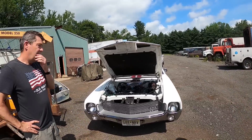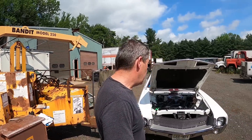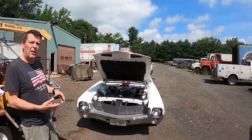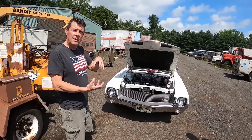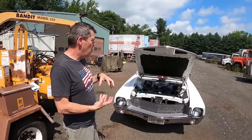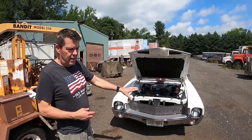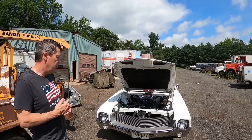They did make a good car — this is an awesome car. Thanks John for sharing it. It's a work in progress — going to continue making it pretty. These cars, up until 1970, had something called a trunnion, which is an old-school suspension system built underneath the coil, and they go bad — you've got to replace the bearing, the bushing. So that was done — all of the front end bushings, the inner and outer tie rods — and it just got a fresh alignment. So it's running down the road real straight.